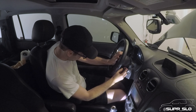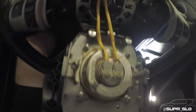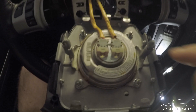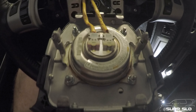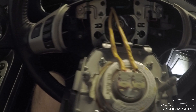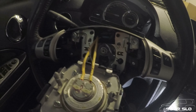Got it. Next step is to remove the airbag part. Now that the center cluster is out, notice we have these two parts for the cables for the airbag. We have these tabs here - we just have to pick them up, lift up the pink and the off-white tab, and then those two connectors will come out. That'll free this entire center cluster, which will then be transferred to the new steering wheel.